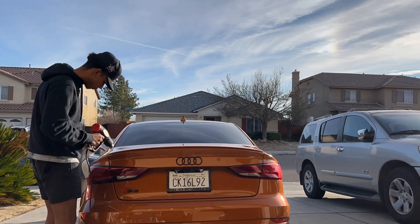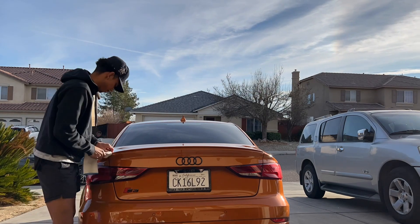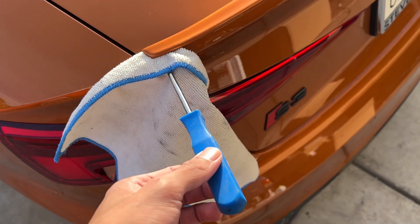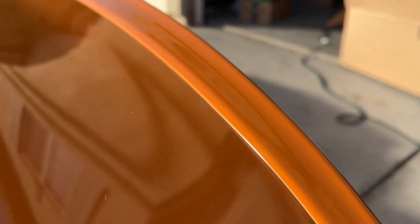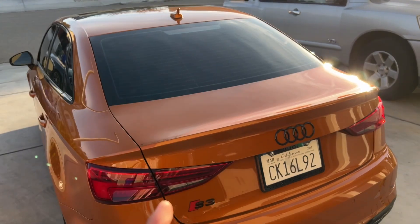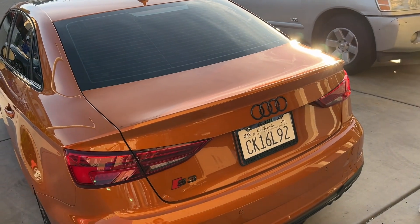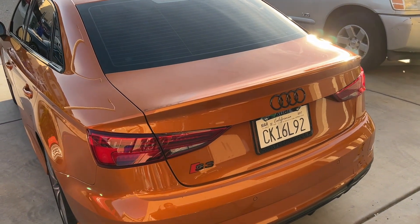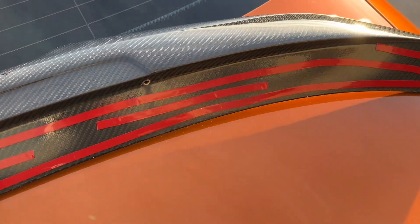What I ended up doing was heating it up enough to get a pick tool underneath with this cloth, and now you can see I kind of lifted it up and I can just start slowly heating it and going all the way across. I got the spoiler off — it took me a little while to get all the adhesive off. I had to put on some adhesive spray and slowly scrape it off, but I finally got it. Now we're gonna throw on the carbon spoiler. This is how I place the tape so that when I lift it up it's already positioned, and when I take the tape off and flip it over, it'll fall right into place.